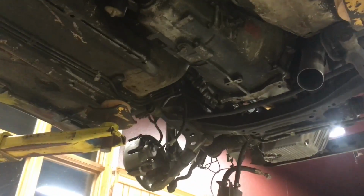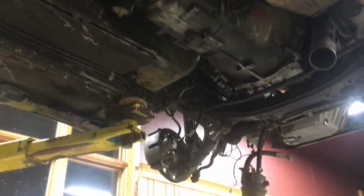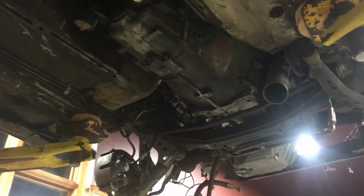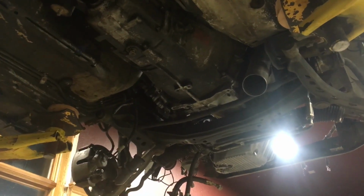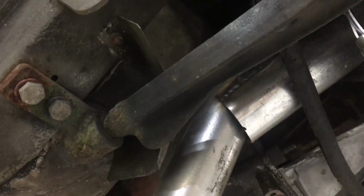Well, I just manhandled the transmission back into this thing to kind of gauge for exhaust clearance. That's what I'm working on right now. Again, I'm using the factory front half of the 2001-2002 M3 headers, which I cut off before the catalytic converter. And I've been fabbing up a Y pipe along the way that'll fit and clear. And then I'm going to do V-bands.